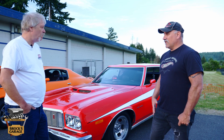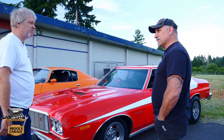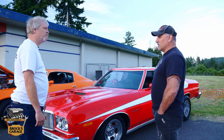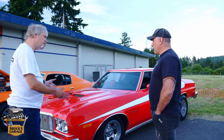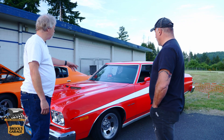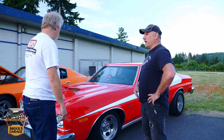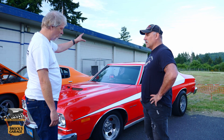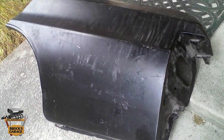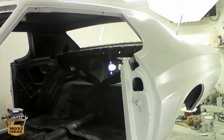So hey John, tell us about your car. Well, when I bought it, it had a lot of rust in it, so I basically did an entire frame-off restoration. How long did that take you? About a year, a little over — maybe two overall, but tearing it down. So what all did you do — you just replaced all the metal in it? Yeah, I had to do floor pans, had to take the cowl apart, separate it — that was all rotted out, which is normal for these cars. Floor pans, a couple little patches in the trunk, and back here I used half of a new old stock quarter panel. It cost me almost as much as I paid for the entire car by the time I got it here.